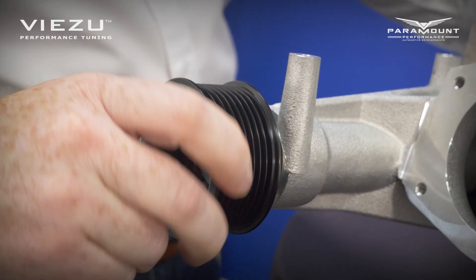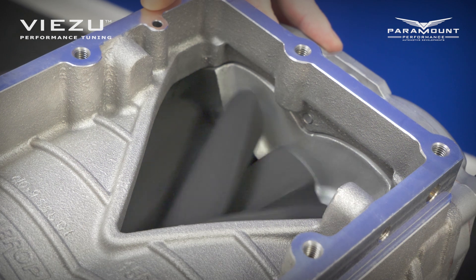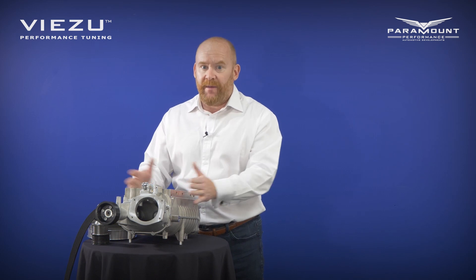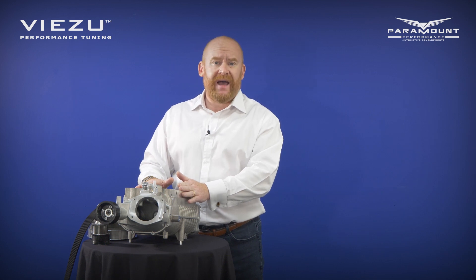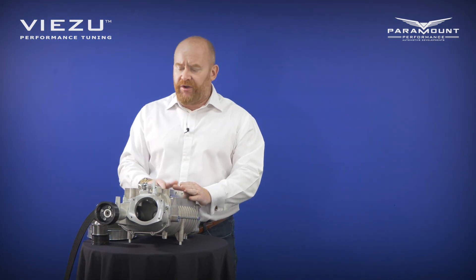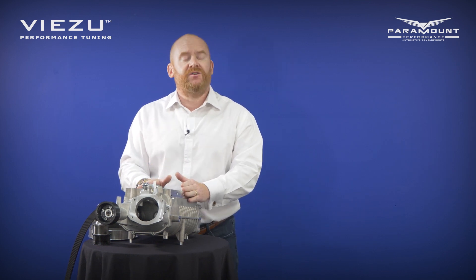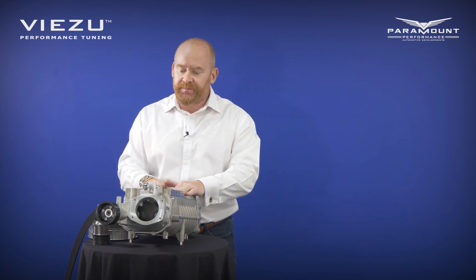The way it does that is a little bit confusing, but it folds the air inside the supercharger. There are two blades that fold on top of each other, literally folding air and pushing it into your engine. When this runs at up to 17,000 RPM, that's an awful lot of air being pulled and folded into your engine. They're incredibly reliable — it isn't a magic switch you turn on and off like in Mad Max. They run permanently from the pulley at the front down to a pulley on the crankshaft, so all the time your engine is running, your supercharger is running. The more revs you do, the faster the supercharger turns.